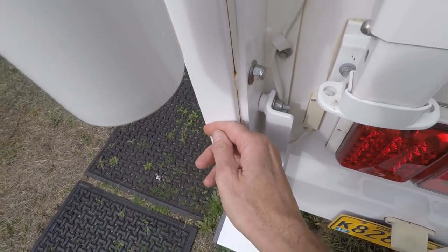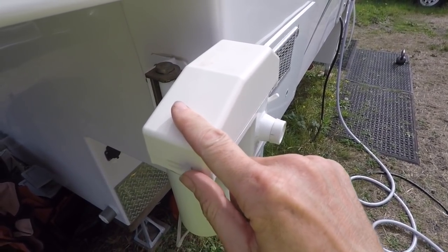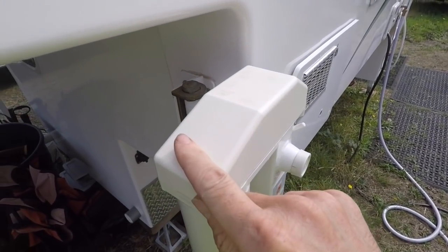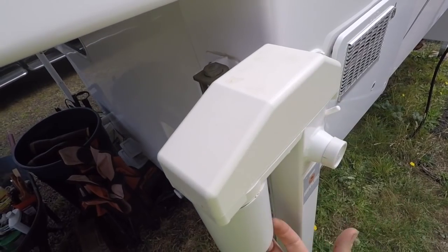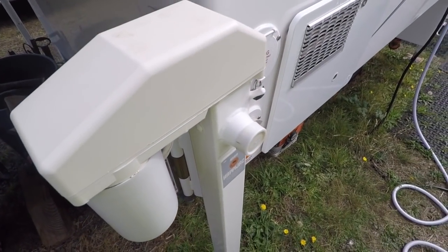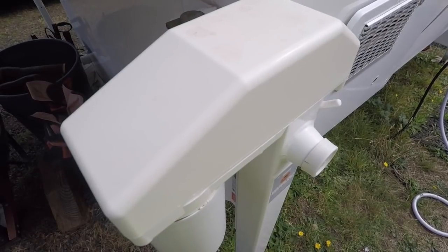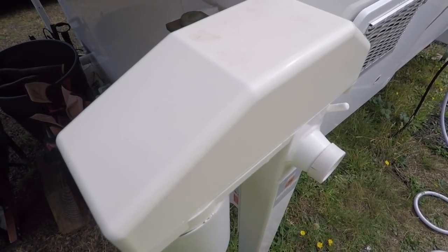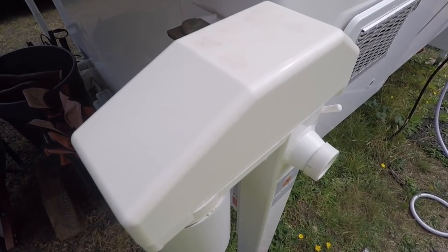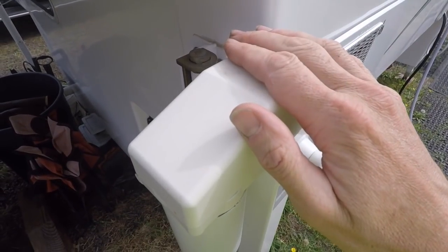A little bit of rust here, but these jacks are powder coated. This particular jack has given me some issues with actuating — blowing fuses. I've only had issues with this jack and I've had to take it apart a couple of times. You remove these two screws, the whole assembly slides out, and the cover comes off. Some of the gears get a little wound up so they won't move, so I've had to unseize them by turning by hand or with a pair of channel locks to loosen it up. I don't know if it's just a faulty part that needs to be replaced, but this is the only one I've had an issue with.